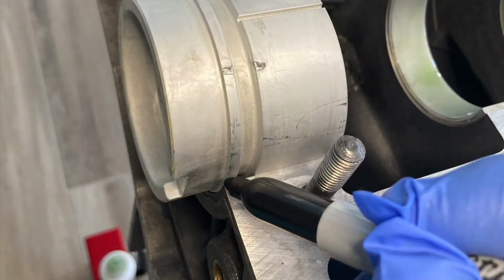The crankshaft itself is pretty heavy, especially with all the rods attached to it. So to make sure that you can have everything aligned pretty easily when you go to drop it into the case, you may want to take the number 8 bearing, put it onto the case saddle area where that dowel pin was inserted, and draw a line there along the left-hand side. That's going to give you another indicator when you're dropping the crank into the case to make sure that things are aligned and it finds the hole for the dowel pin fairly easily.